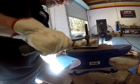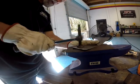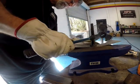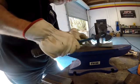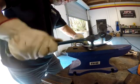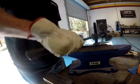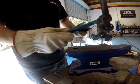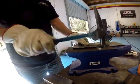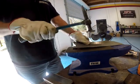I'm trying to sharpen up that bend on that flange a little bit. As you see, I'm striking and kind of scraping at the same time, or pulling away from that. Every time you hit your sheet metal with that hammer, or any hammer, you're changing the shape of the metal. What I was trying to do is see how it's changing. It's actually flattening it out, but you're also kind of changing the structure of the molecules in there. You're stretching them. But it's going back into shape where that panel's flat.